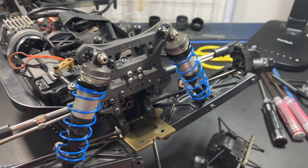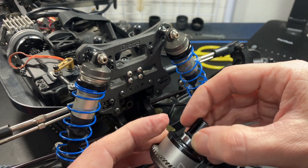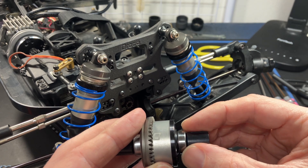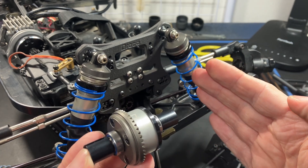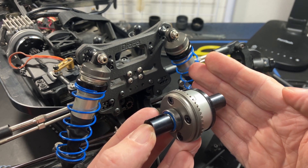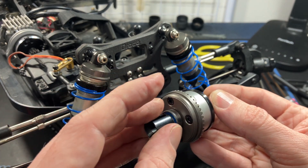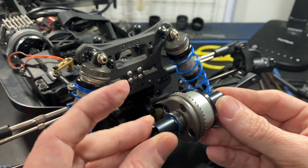What I've done is added a 0.3mm shim behind between the cap and the bearing to start things off. I'm going to add 0.8mm of shims on the out drive side — quite a lot — and this is a good starting point. You want to set the diff as far to one side as possible, check the mesh, and then add shims on the other side to mount it properly so it doesn't move.